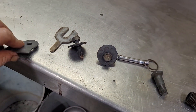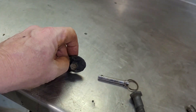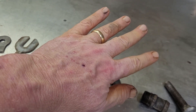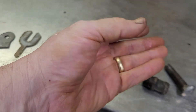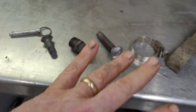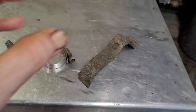Except for stainless and chrome — this chrome moly one actually turned out pretty good. But you can see it's already started to flash rust because whatever coating was from the factory is gone — that's just the surface paint. It takes it all the way down to bare metal. And I want to warn you — this is the staining just from me handling that liquid. It stained my hands — I've washed three times, twice with Lava and once with Dawn, and it completely stained my fingers. So I'd suggest wearing a glove if you're going to let it sit for a week. It leaves the texture on it but takes everything all the way down to bare metal, and it's even starting to flash rust a little too.